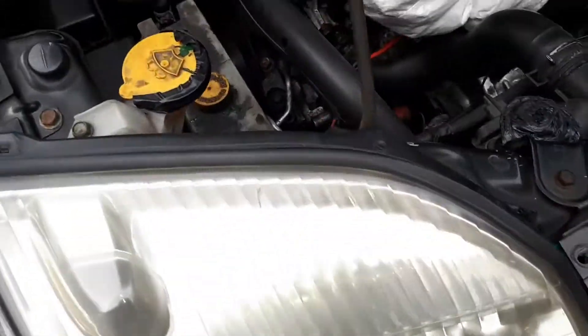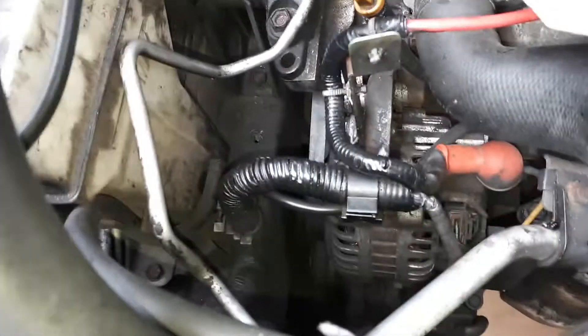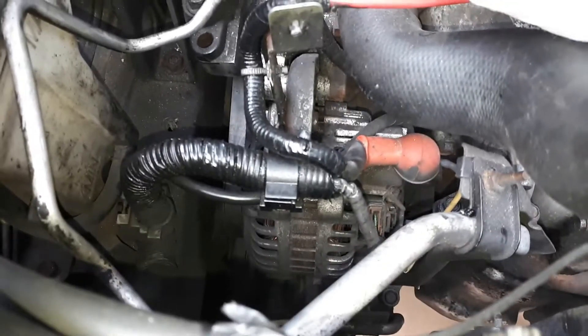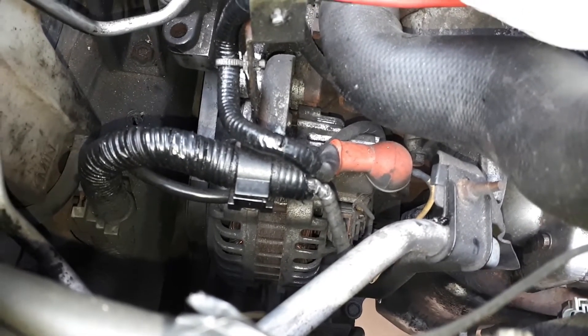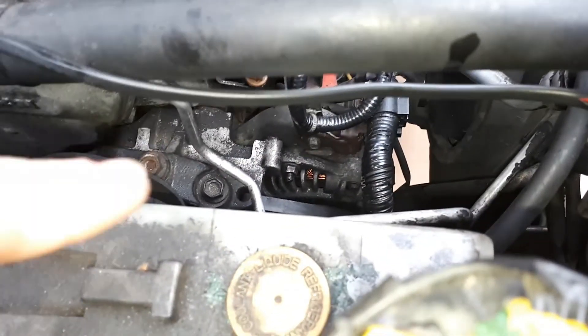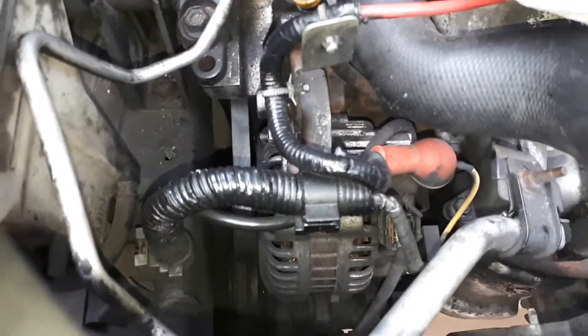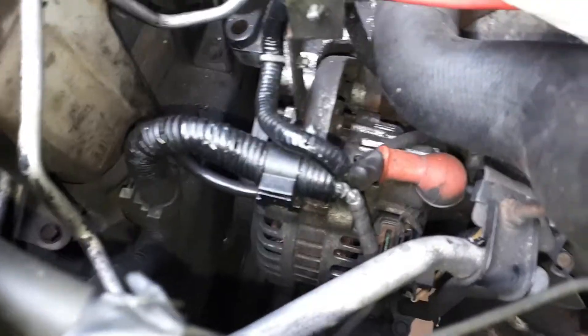The alternator is just behind your headlight down there. If you look down from your screen wash tank, that's the alternator. The alternator in this particular model has two bolts allowing movement. Some alternators you'll find that as soon as you loosen the locking bolt, you can work and move it backwards and forwards. This one's a little bit different — even if it's not obvious, there's another bolt. So first use the 12mm spanner to loosen that bolt there, and then there's another bolt.